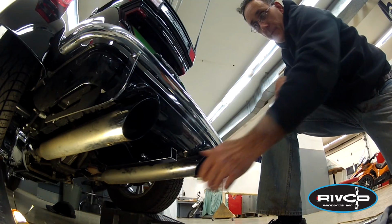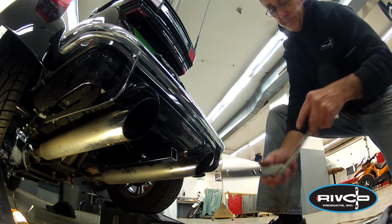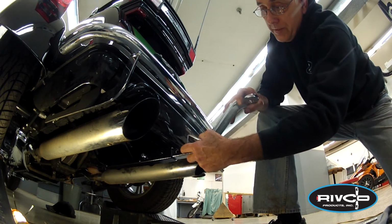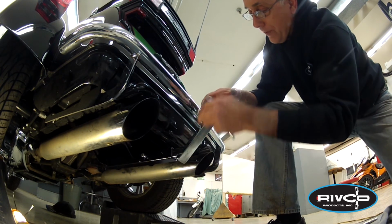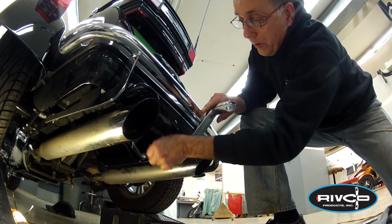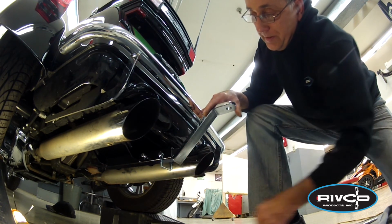So now we have the main frame of our hitch installed onto the frame of the trike. We're going to install the tongue, shiny side up, into the receiver. You'll notice it's got 2 holes on it. Typically the farther forward hole, pulling the tongue farther forward, is where you want it. You can put it back farther if you have a trailer that has a large coupler on it. I'm going with the forward hole. Put your pin in the hole, locked and clipped. That's it. The other thing to know, put your ball on.